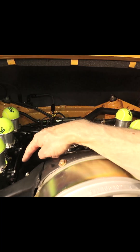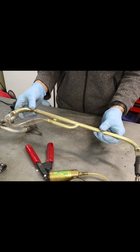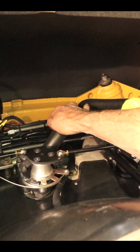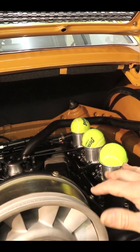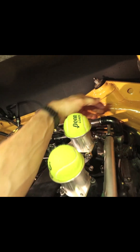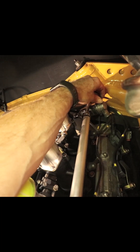This bank has the same air rail on the throttle bodies as cylinders 1-2-3. There's a pipe in the back which is brass — it connects the left and right bank together and has a T-junction here in the center. At the end of this T-junction is essentially an average of all the different vacuum signals from each of the different cylinders. The plumbing continues right after this T-junction into the idle control valve. This engine doesn't have the air cleaners finished yet.